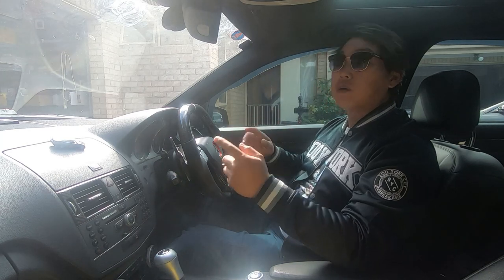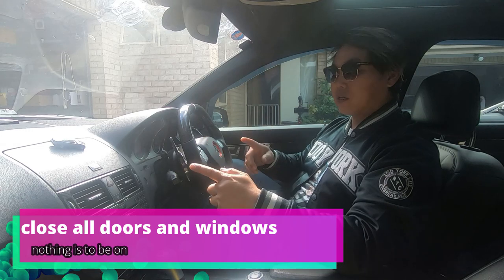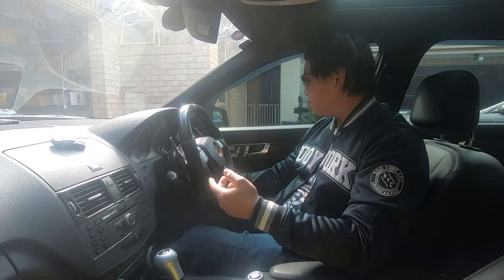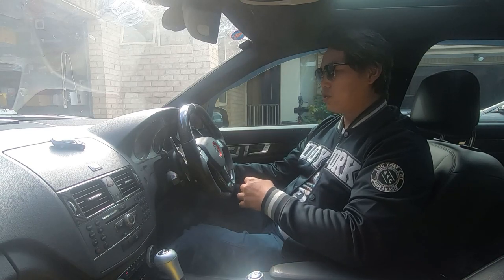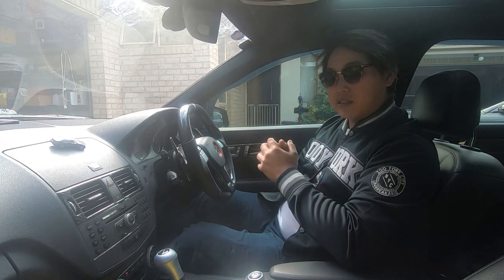The first thing you want to do is make sure your sunroof is closed, your boot is closed, all your doors are closed, and make sure your radio isn't on, your heater isn't on — nothing is on. Then grab your key, put it in your ignition and turn it to the second position. Now depress the accelerator pedal all the way and hold it for five seconds.